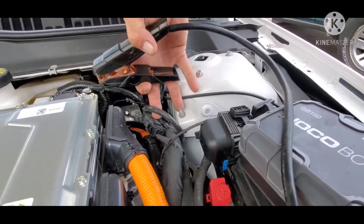So if you're using jumper cables, you'd want to know how to use them on this. You could just put your red positive on here, your black negative on there. Then you would hook it to the jump car that you're starting, then you would start this car, disconnect or shut off the other car, then disconnect this one, and then you'd have your car started.